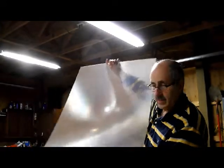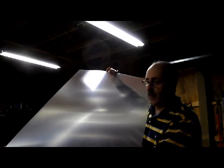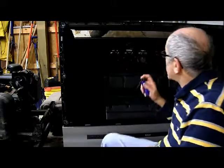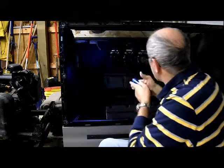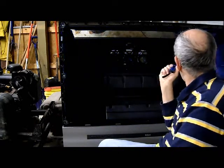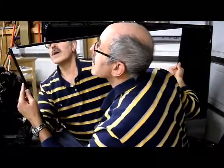It took about ten minutes to get it out of the TV. I'm going to put the TV back together after I take out the lenses and the mirror inside. Here we are with the inside of the TV — we've got the Fresnel lens out. This mirror is actually very thin material. Rather than peel it off right now, I'm going to take it out intact so I have the whole mirror already mounted on a board. The mirror is held on with just four screws, already nicely mounted and firm.